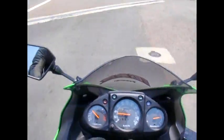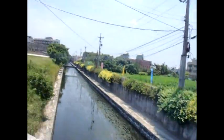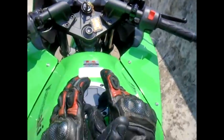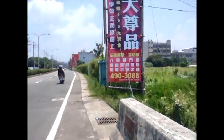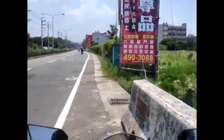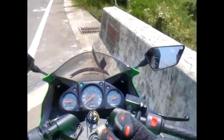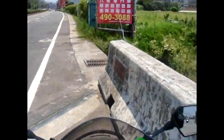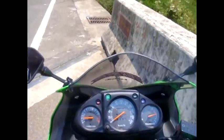This bike right now has a modified exhaust pipe, and this pipe is actually designed for a 600cc bike. It's put on this 250, so right now this bike is actually slower than a stock bike, because the exhaust is designed for a larger bike, so there's not enough pressure going through it for the bike to really have free flow exhaust. So what that means is, until you get to the higher RPMs, this bike is gutless.